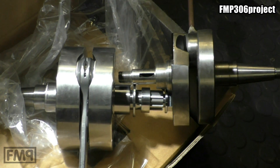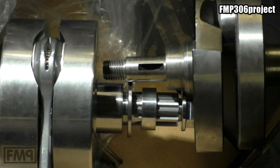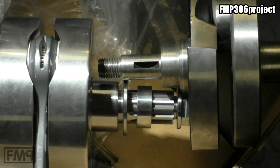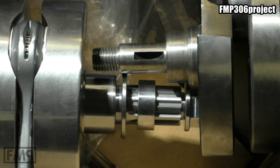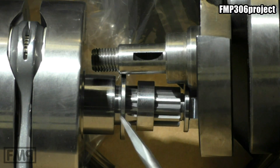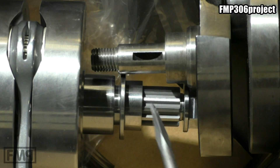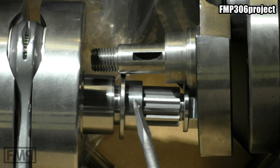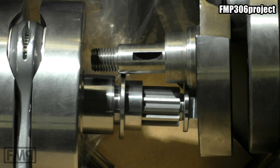The big question with this expensive stuff — this engine is about 6,000 to 7,000 euros in materials without any labor — is it on the road faster than just the Quattrini 244 setup? We'll find out. Little difference here: it's just the Woodruff key, and it is way thinner, so that's needed for a lot of power — just a bigger timing shift.